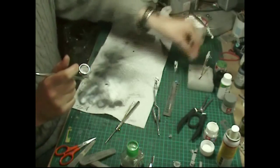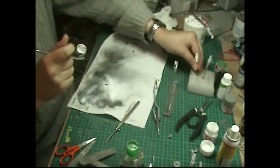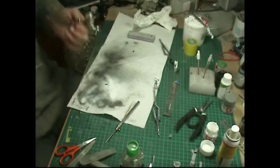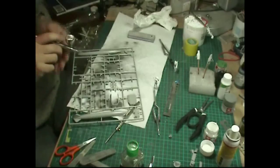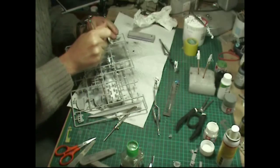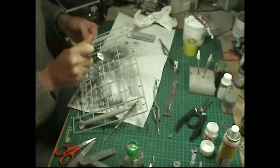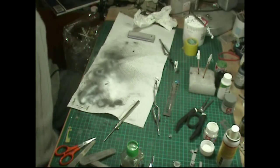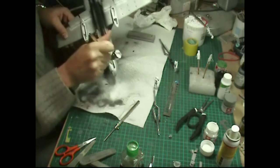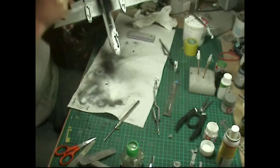That build-up on the nozzle tip gets deflected by the airflow, sticks there, and every now and again that big lump will flick off and land right on your nice paintwork and ruin it. So every now and again come along with a clean wipe and literally pull it right off. Now we can carry on spraying — there's a nice little moment to show you that tip. Now with a wet mix we can spray all those areas for a nice glossy finish.